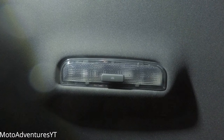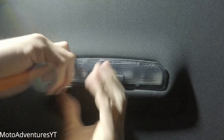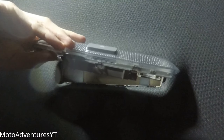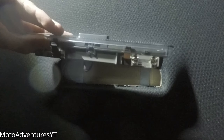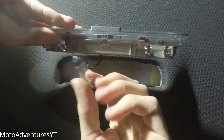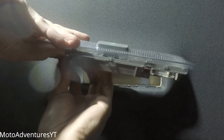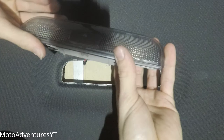Now starting with the rear light — use your prying tool and go around the whole light to get all the clips out, and it just falls straight out. This one's simpler: the bulbs are right here. Use your pry tool to pry against the bulb — that one's already come out on its clips. Get your LED replacement and it's a straight swap — push it in and once it's seated, test the bulb.